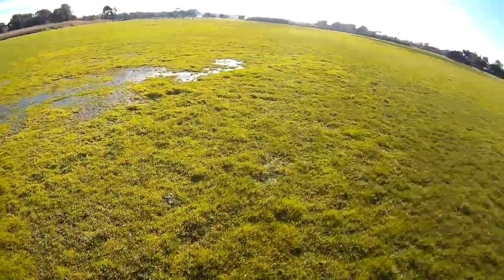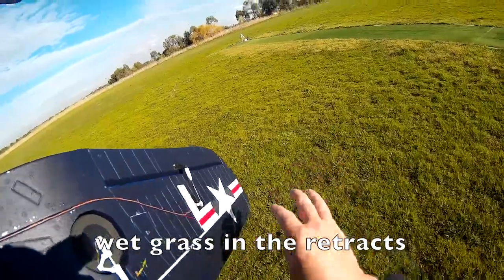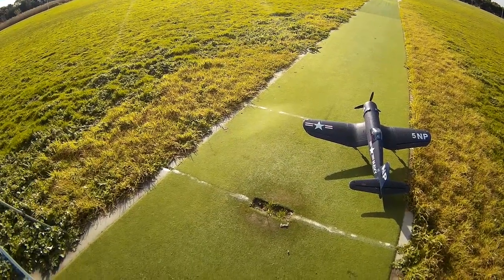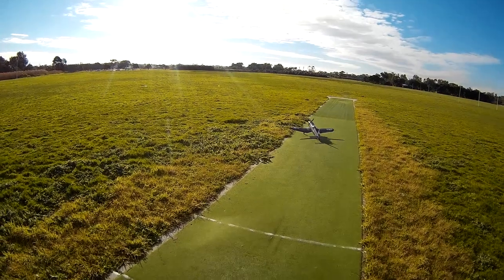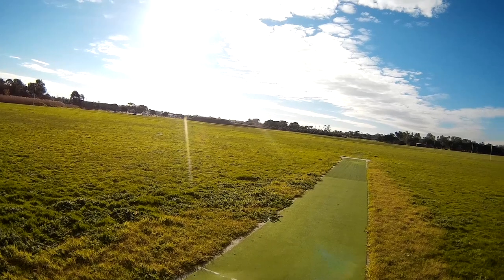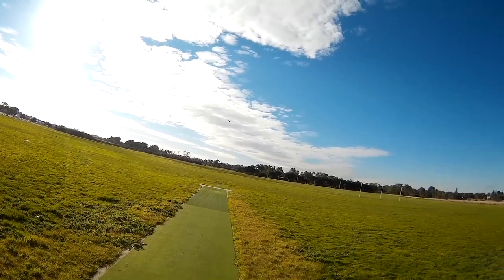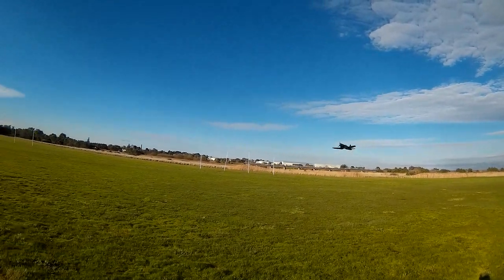Look at the water around there. I've programmed in some rates for the ailerons — I've got 175 and 50 percent. I'll give that a go and see if I can get it to fly a bit more smoothly. 50 percent ailerons, and that immediately feels a lot nicer. Smooth low pass — sweet.